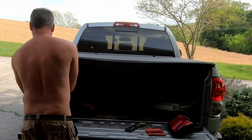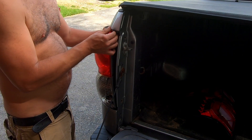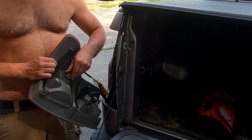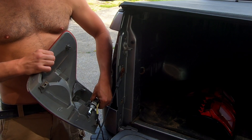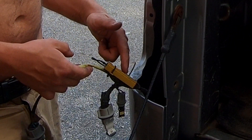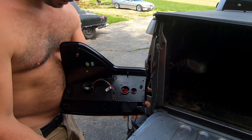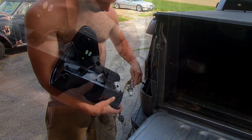There are just two T30 bolts holding the lights in. There are also a couple of little tabs on the side — you just turn them to the left to remove them. You can see there's the brake light bulb, the turn signal, and the reverse light — they're all LED already, which is why I don't have hyper flash on my turn signals. To remove them you just pop the turn signal and reverse light right out.